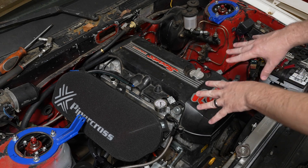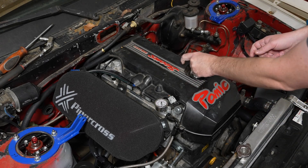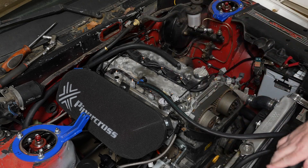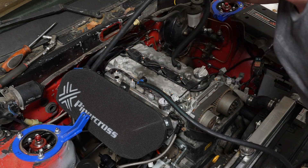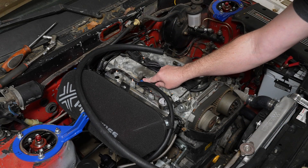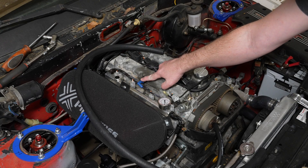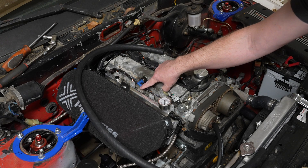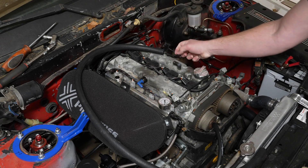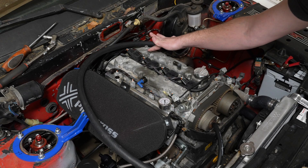Let's go over the system on the car. My engine is far from stock, but to access the PCV system we're going to pull the beauty cover, which is just held on by the oil cap. I'm going to pull these hoses out and around so you can see everything more clearly. This valve cover has two different breathers on it — we've got your PCV valve on this side, that's this blue guy here. This is a PCV valve from a 2JZ; it's just got a 90-degree angle on it to make it easier to route. You can actually jam a screwdriver in the fitting and rotate it. It's almost like the valve cover was meant to have it run this way because it's got these little divots on it.